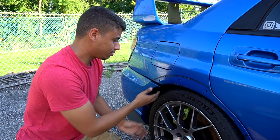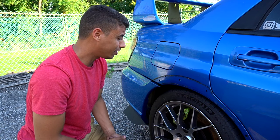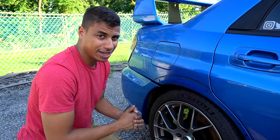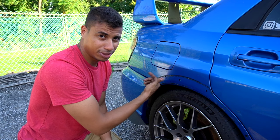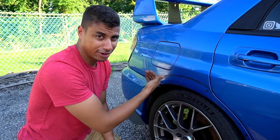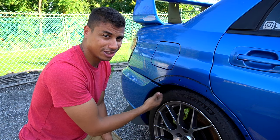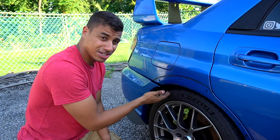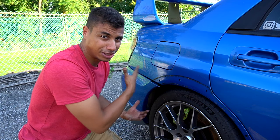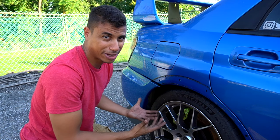So now, instead of just popping this off and being able to clean this up and go on with my install, I have to try and either back out the bolt because it's broken off into the nut, or I have to drill another hole and fabricate something so I can attach my bumper — I can't just leave it like this. As I drive, it will come off, catch wind and air, and I don't need a parachute on the back of my car.